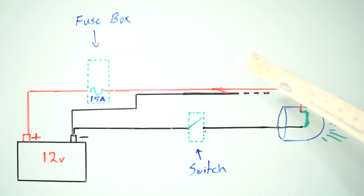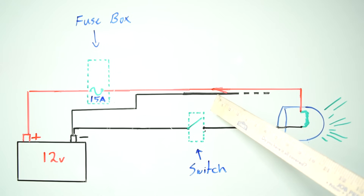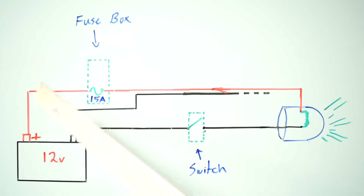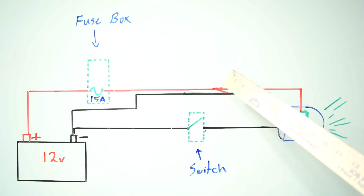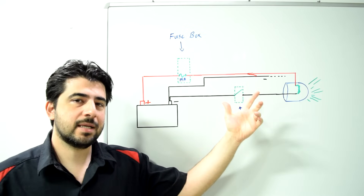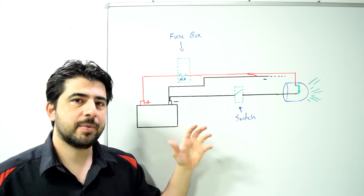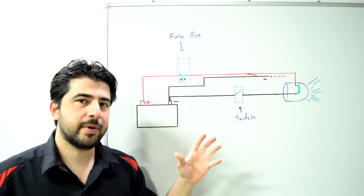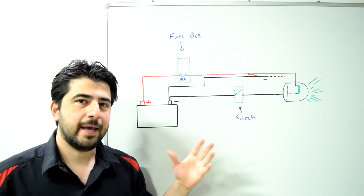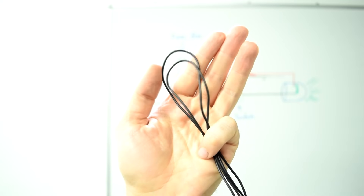So here's an example of a positive short to ground. On this circuit we have a damaged wire on our positive side that has shorted to a damaged ground wire. Electrical current, instead of going through this wire to our load which is our headlight bulb which has some resistance, just goes through this ground wire that has no resistance back to our battery. And when this happens you're basically shorting out the battery. Without the load to offer resistance to current flow, the battery will put out its maximum amps — a car battery can put out quite a few hundred amps — and when a few hundred amps flow through these tiny wires they get really hot real quick, and that's how electrical fires start.